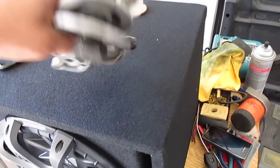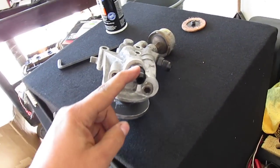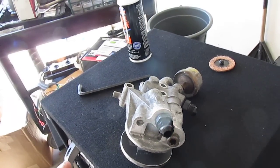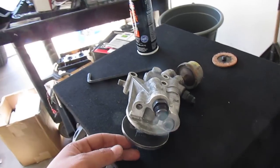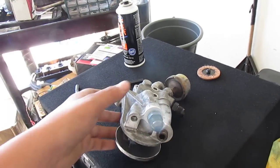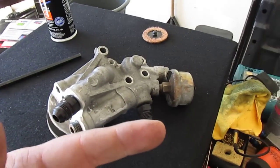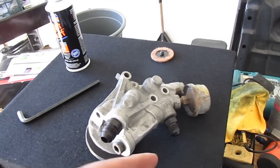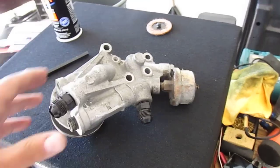The filter side is going to be plugged — it's going to force the fluid through this AN fitting, which is in turn going to go through my frame-mounted oil filter, which is a PH8. It's a Ford Mustang filter, a decent-size V8 filter. Then it goes through my 18-pass oil cooler with the fan on it, and the line comes back and goes back into the engine.